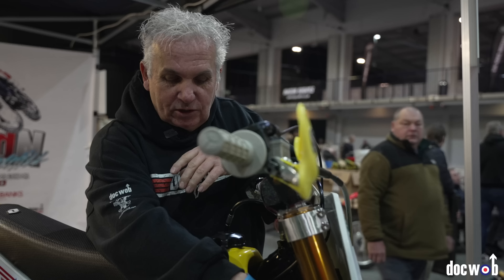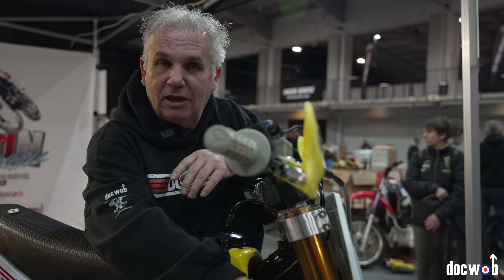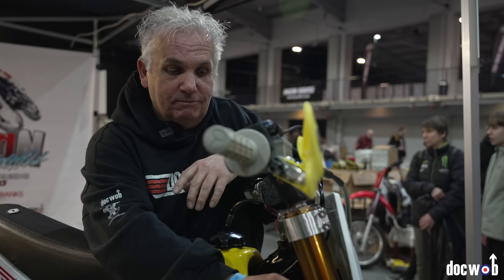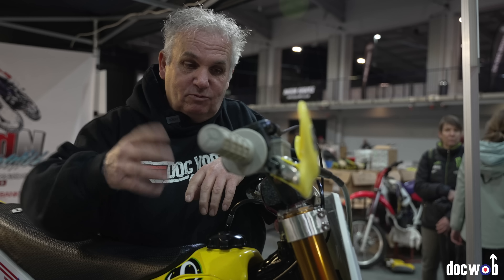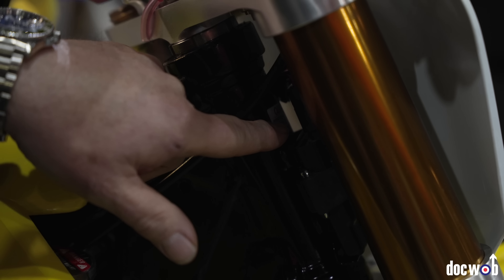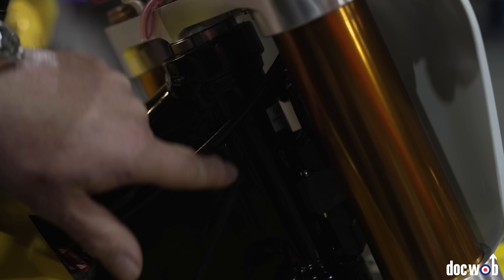So this one is a 2008 RM250. We built our parts because there's a lot of factory parts on this one. We did it up as a Travis Pastrana 2003 graphics with Asobi, only because I like Travis - I worked with Travis for four years on the goggles. Lee McCollum, who was Travis's mechanic, is one of my best friends, so I kind of know what the bike should be and what it shouldn't. So this is a full factory frame, factory linkage, factory foot pegs, a race team Pro Circuit pipe, carbon silencer, full titanium bolt kit, A-kit suspension, billet clamps, mag rear hub - it's got everything, it's a proper thing. I was a little bit nervous building Suzukis because I love them, but not everybody else does and everyone wants a Honda, but I love them.